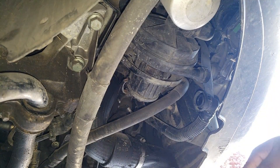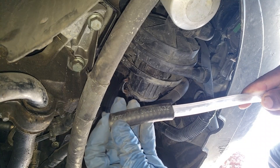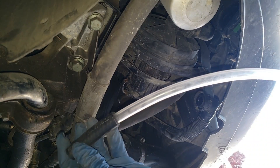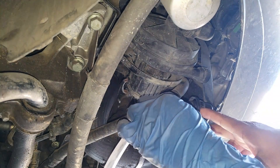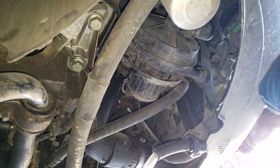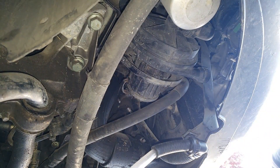I've created this tool — it's a piece of hose, part number Armormark 50291. It's connected to a half-inch outer diameter clear hose and it fits in there perfectly. It's an interference fit and from there I can just blow into it, making a perfect tool for this diagnosis.